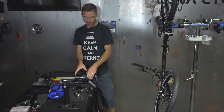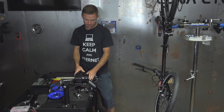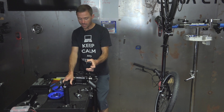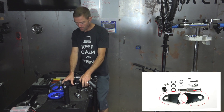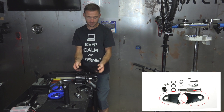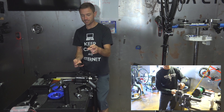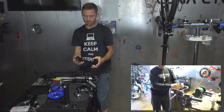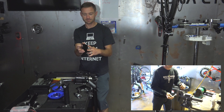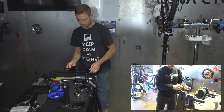All right, so we're going to show you how the new install is on the Cyclone 3000. The first thing that you need is one wide bracket, one thick bracket, and then one bent bracket. The reason we have two here is to show you that it comes bent a certain way that works for a 100, but to make it work for a 68, you have to add some bent at the bottom and some bent at the top. So we're going to ignore this stock 100 and use our pre-bent one.